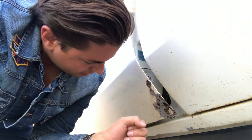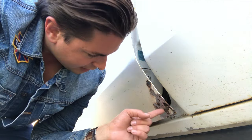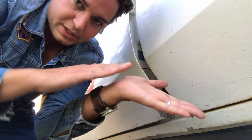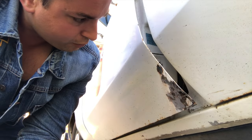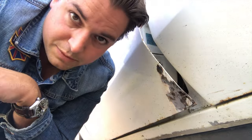I've started to grind the rust away and what I found is that this has actually been filled once before. Because I'm not doing a proper weld on this and that filler seems to be holding up back there, I'm actually going to leave that as a backing. I've got the perforated rust taken away, and what you want to make sure is that the surface you're going to be filling is actually sort of concave so the filler can go in. If you have a bump sticking up, you're going to notice that in your paint, so you have to make sure it's a little bit concave before you start filling. I'll need to grind away some of that redness and the rough spot, and after it's smoothed down a bit it should be ready for filler and sanding.